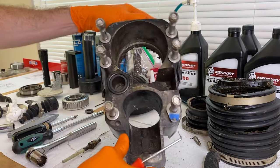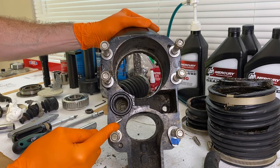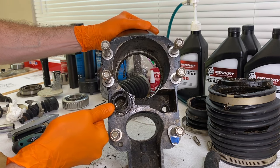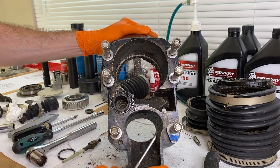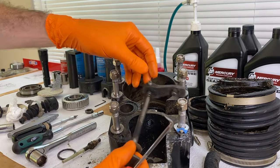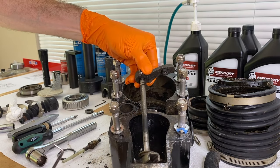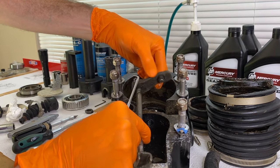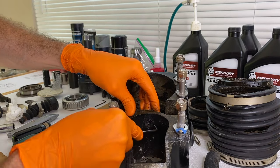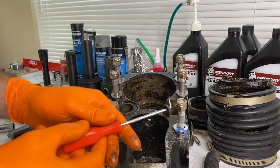That leaves the water tube O-ring — do your best not to gouge or scratch anything while removing it. That just comes off cleanly. Down below there's one additional gasket — that's the gasket that creates a water-tight and oil-tight seal at this point with the shift crank or shaft through that hole, operating in conjunction with the shift cable. Remove that gasket carefully.